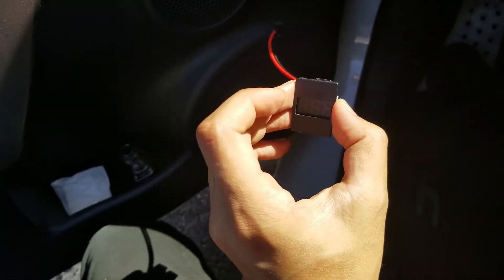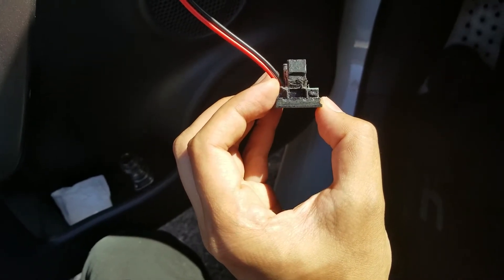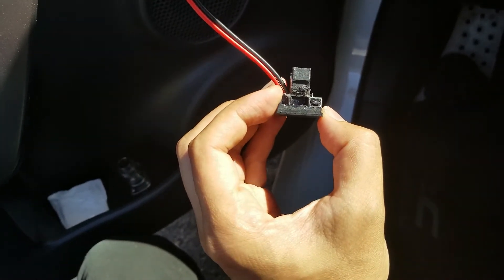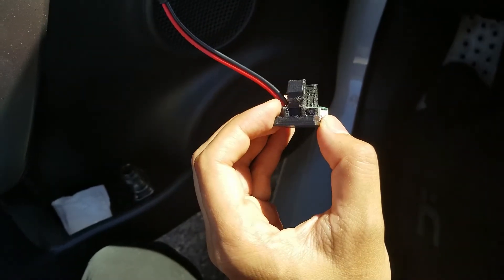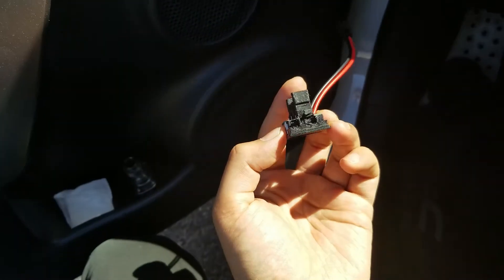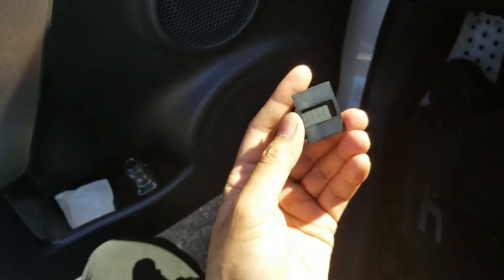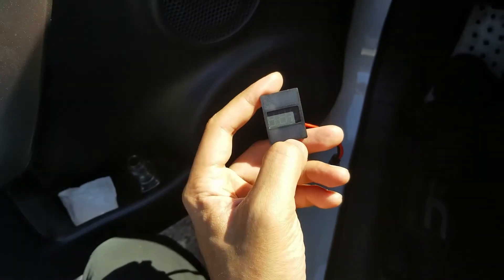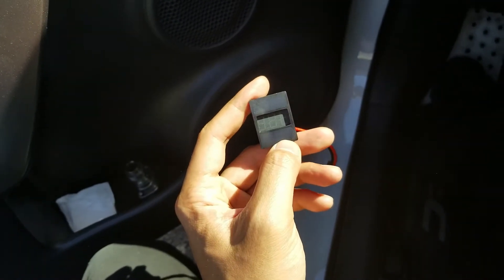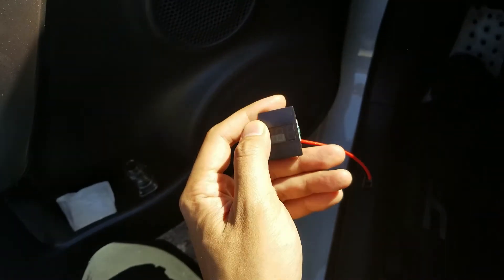Top and bottom was fine — just the left and right was a little bit too wide. If you look there you can see where I've trimmed back about a millimeter and then left a little lip on the front as well. So once you do that this piece will fit in perfectly. I also got rid of the shiny finish on here so that it matches the matte black of the rest of the buttons, by doing a wet sand starting with 600 grit sandpaper and then a thousand grit, and it actually looks pretty nice.